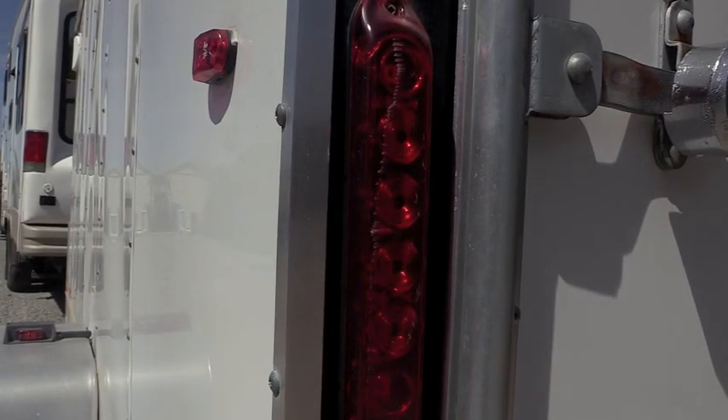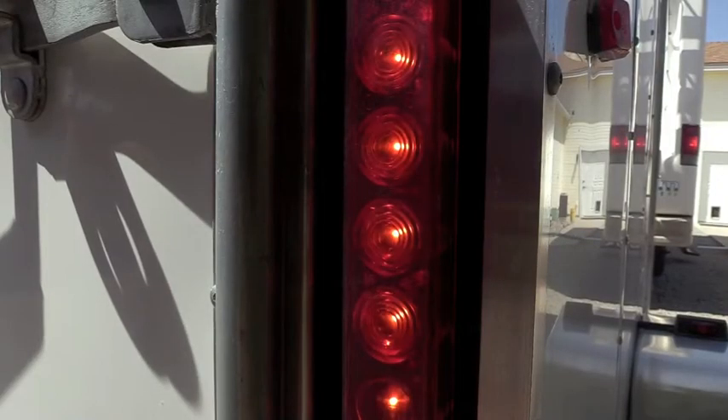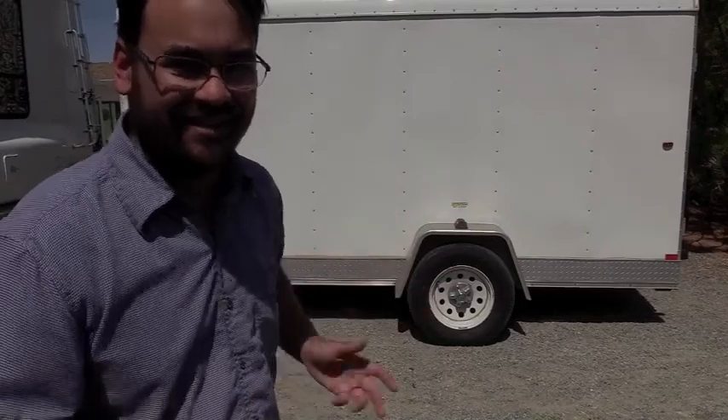For the lights, I tapped into the factory brake lights and ran a wire down to that seven-way plug. The reason I did it this way was in case our truck became disabled — I want to be able to hook to a different truck and at least have lighting on all of our trailers. If the fifth wheel still had lights, the second trailer would too, so even though the brakes wouldn't work, I could at least limp it down the road in an emergency.